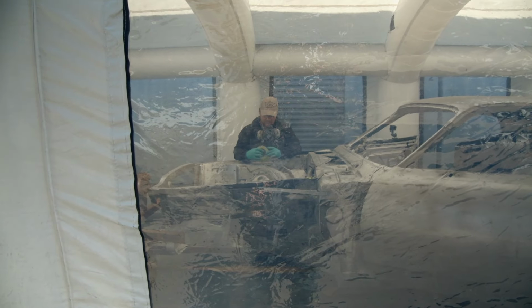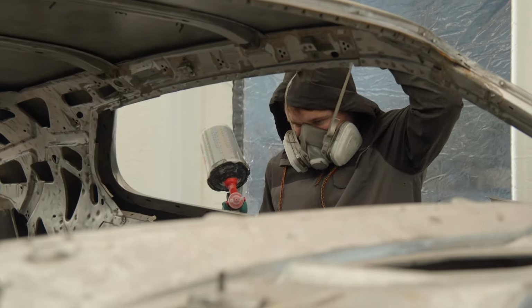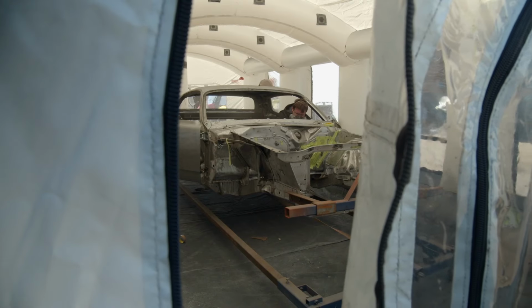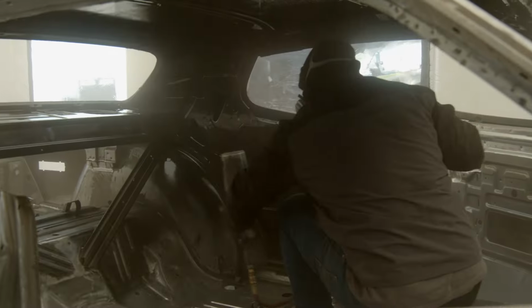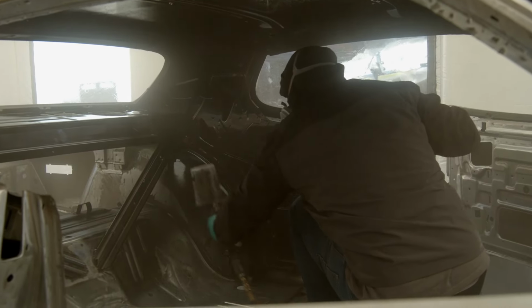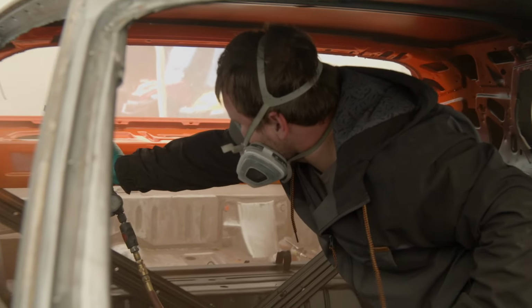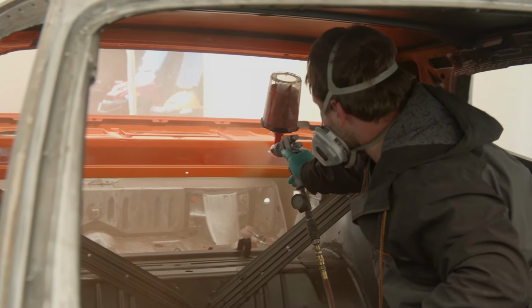That's the car. The car is already bare metal, so it's just a matter of getting it in the booth, wiping it down, making sure that metal's nice and clean before you do anything. Then after that, he'll go in, apply the DP90, because paint doesn't stick to bare metal. DP90 is great for the adhesion process. He'll put the EV2 Hemi Orange on top of it. That car's jammed, it's protected, and we can move it on to the next phase.